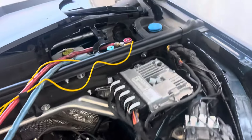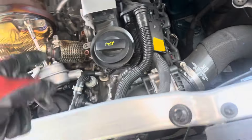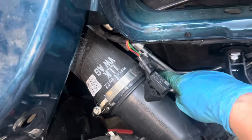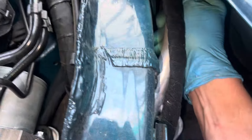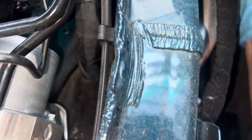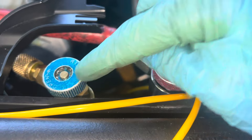The AC fittings are hidden behind this panel here. You can almost not see them - if the fascia cover was over the bumper you wouldn't see all this. You have your AC lines coming here - there's your suction line, your liquid line. Follow them up into your heat exchanger. It goes into one single line as the liquid line goes into the heat exchanger. Follow your hand up, the heat exchanger goes around here and comes down inside here. These are just little extension tubes coming off.